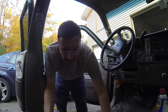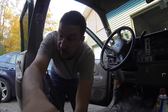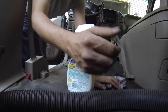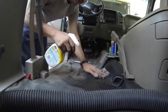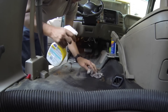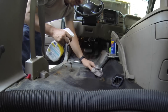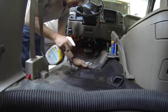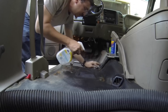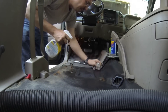Now I'll have a power seat. I'm cleaning up this side of the floor, then I'm gonna install this seat which does have a plug, which will at least get me part of the way there. I noticed it's a two-wire plug and the other one has a three-wire, so I'll have to figure out what's not working and then work on getting it working.